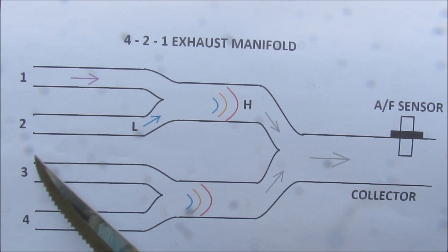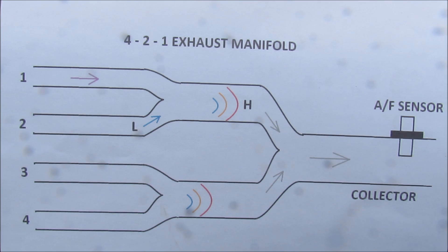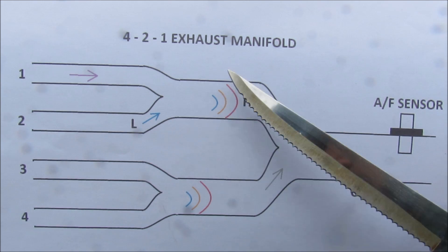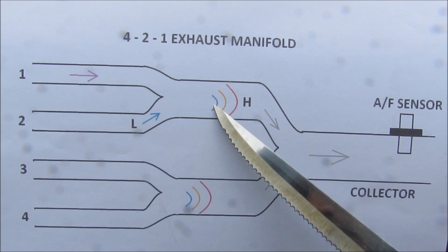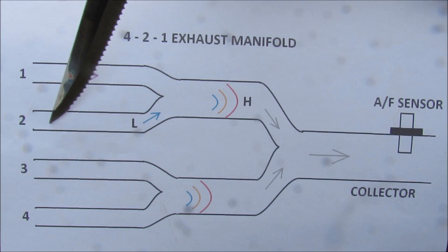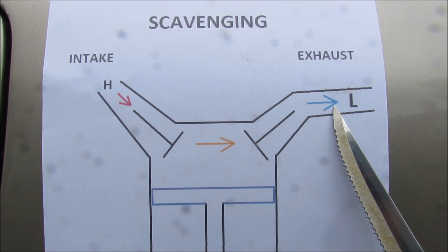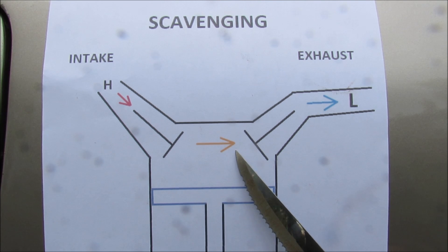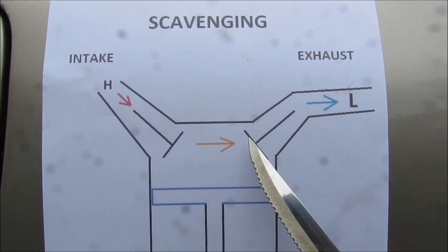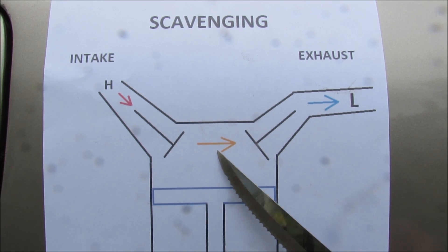OEM has specifically tuned it for optimal performance and sound for this engine. The function of the exhaust manifold is to collect all of the exhaust from each of the cylinders. Each cylinder releases exhaust gases at different timings, and those exhausts come out in pressure pulses — with the front having high pressure and the back having low pressure. As the pressure pulse travels along, it creates a low-pressure zone which helps suck out exhaust gases from the cylinder. This effect is known as scavenging — when the low pressure from the exhaust pulse helps to evacuate remaining exhaust gases from the cylinder, and also helps bring in fresh air from the intake at the moment when both the intake and exhaust valves are open at the same time.